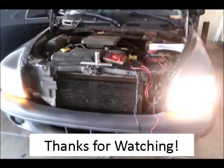Let's check the headlights — we've got headlights and taillights working like we wanted, same intensity. The power door locks work too. The main thing was fixing the headlights, which we did. This module controls a lot of the accessories on the vehicle — the wipers work, and most things are functioning. If you have a problem with the headlights on your 2001–2003 Durango, especially if one is dim and then they stop working, there's a good chance this central timer module is going to be the culprit. This is Steve Story from Car Inspectors — I hope you learned something today, please subscribe, thank you.